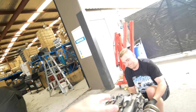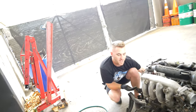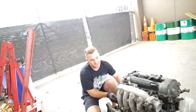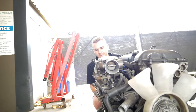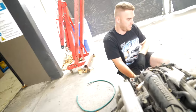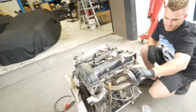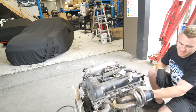Powder coat the rocker cover. We've got a turbo manifold situation to go on there. Chuck a new oil pump on it. I'm going to flip it upside down — got a typical JDM import motor with silicon everywhere. Along with the new oil pump, I'll flip it over and pull the sumps off, check bearings, maybe throw bearings in it. Try and find a DE throttle body because the DT ones are restrictive as hell. Zinc all the bolts, make it look real cool. Decide what color we're doing the rocker cover, make this thing look jazzy. That manifold? It's going on Facebook Marketplace.